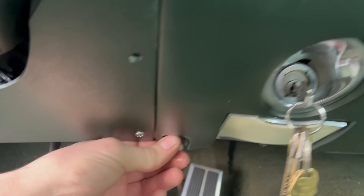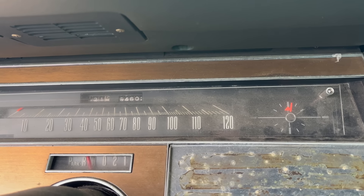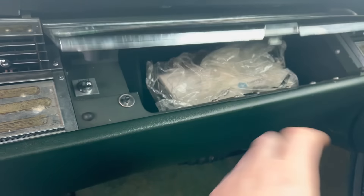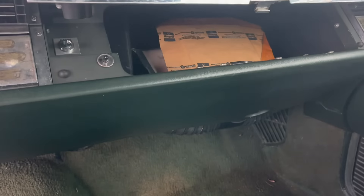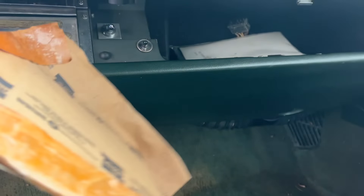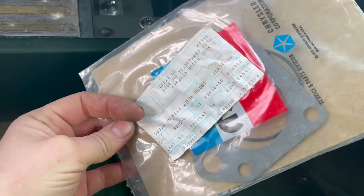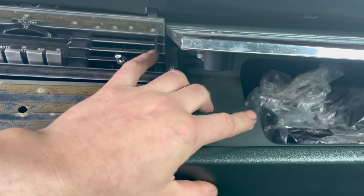I found a random knob, and it's the trip meter reset. It might even work. More coolness — the glove box. In here there's a factory glove box manual. USAA Automobile Portfolio — nifty. There are also some random parts, like a power steering pump seal kit and an oil pump gasket. The flasher switch is hidden in here as well. And there would definitely be a glove box light if we had a battery.